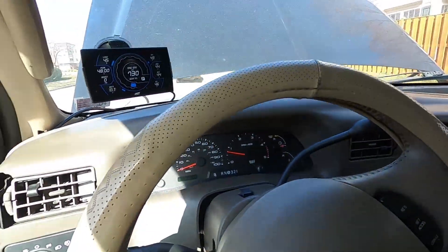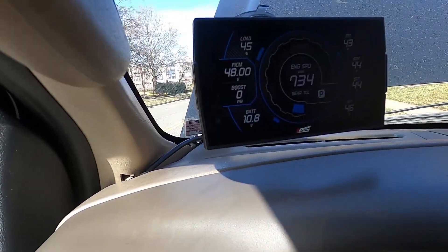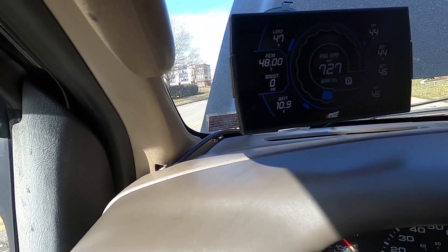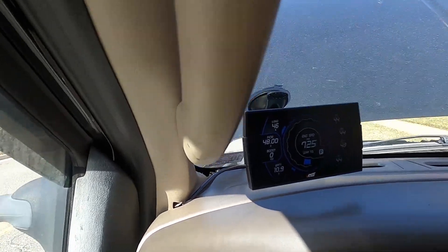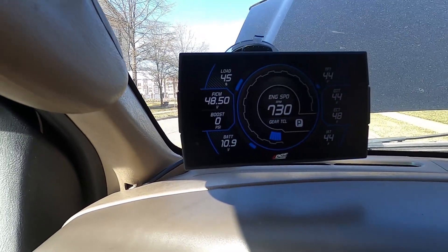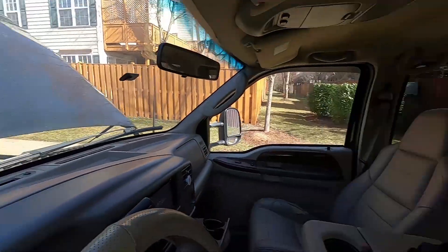There are two remaining things I'm still figuring out. It seems like there's a slow power draw — when I started it just now the start didn't sound super strong, pointing to the batteries. Either there's an issue with the new batteries I got, or something is slowly drawing current. Once it warms up the alternator really kicks in and goes to around 14 volts, so it's not the alternator. I also have the Edge CTS3 monitor, and I'm a fan of it so far — I've only had it for about a week.